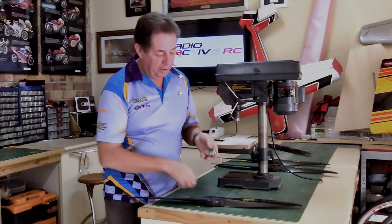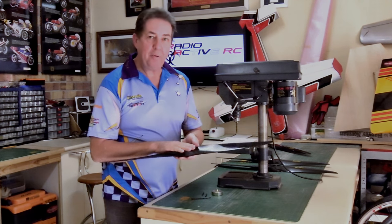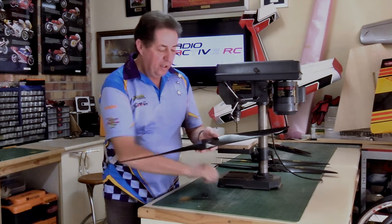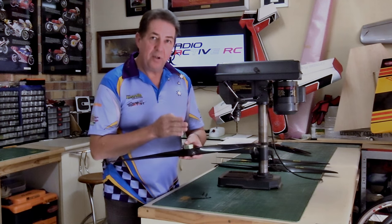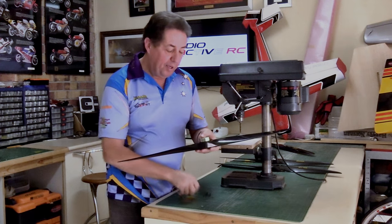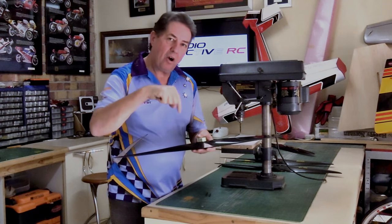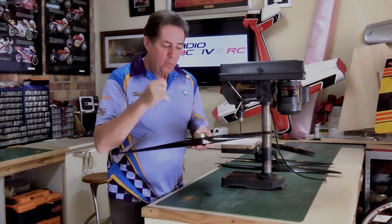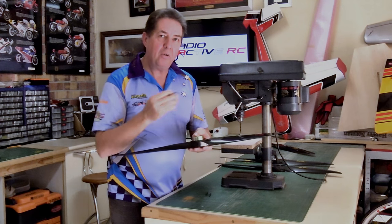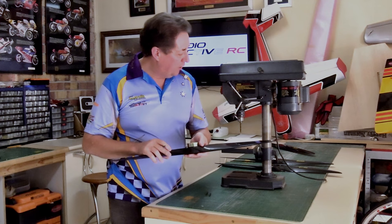My preferred method for drilling is to drill from both sides of the propeller. I start from the rear — no matter what you do or what methods you use, always start from the rear. When you put the drill jig in and start the drilling process all the holes are going to be the closest match to the prop hub. The problem is if you drill from one side continuously, the drill bit itself can track off and you won't notice this. So my preferred method is to drill halfway through, flip it over, finish from the other side — clean hole all the way through.